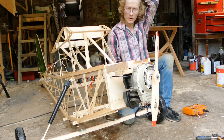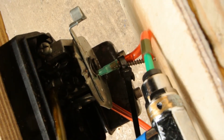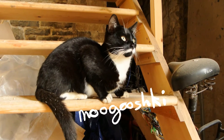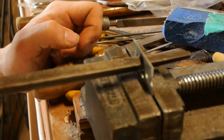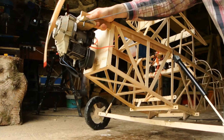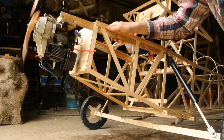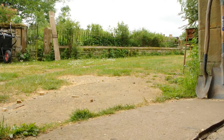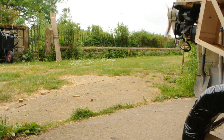Now the engine is gravity-fed with a syringe needle and a little valve to turn it off so it doesn't leak fuel on the floor. I also had to hand fit a small retaining bracket for the rear of the propeller to union it with the bolt that holds the flywheel magneto to the engine. It starts quite adequately now and runs about half choke because of the diameter of the needle. I've ordered a larger propeller from Hobby King, but the current one is enough to taxi it around the yard, which means propeller and weather dependent — we are go for launch.